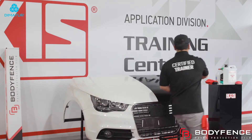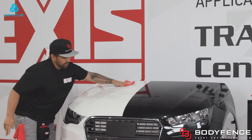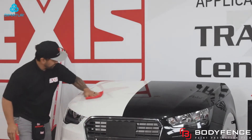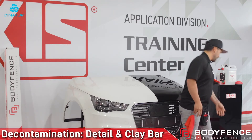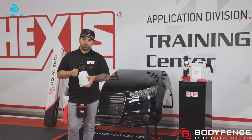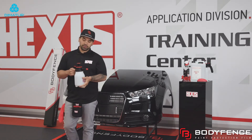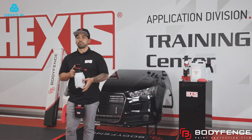So I'm going to spray the entire hood. I usually split it right down the center and go outwards so that I can watch what I'm actually doing. Once this process is done and the hood looks nice and clean, I'm going to grab my soapy solution. For my soapy solution, I just use any liquid soap and some water. The process I'm going to use right now is I'm going to clay the hood to remove any minor contaminants that are embedded in the paint.